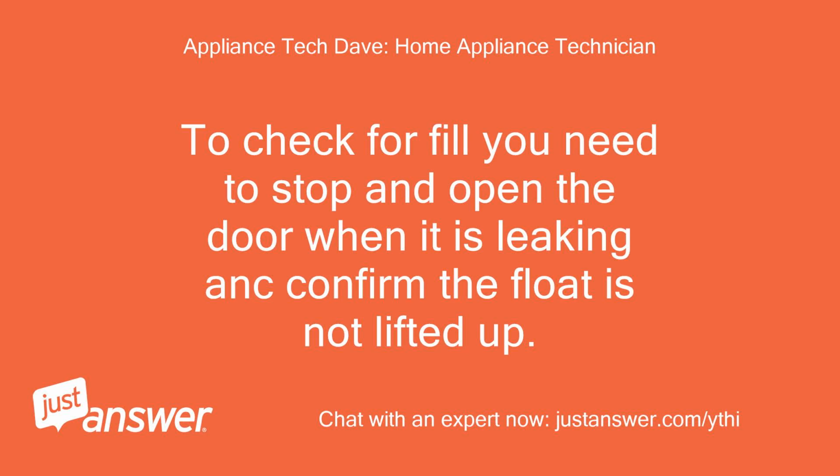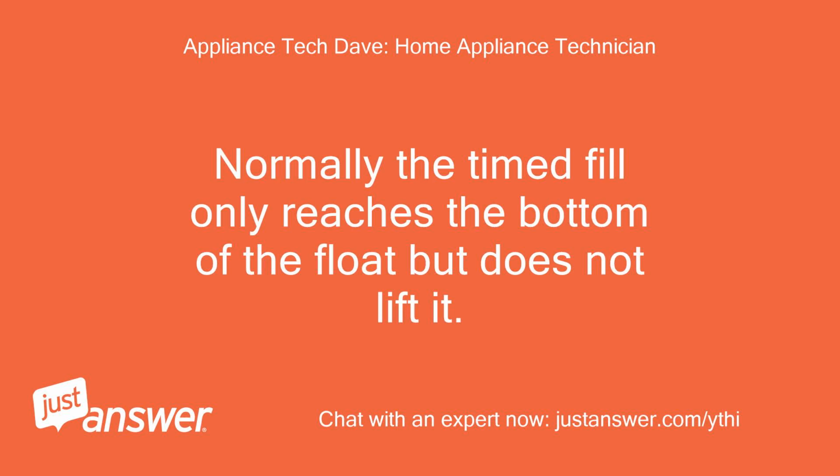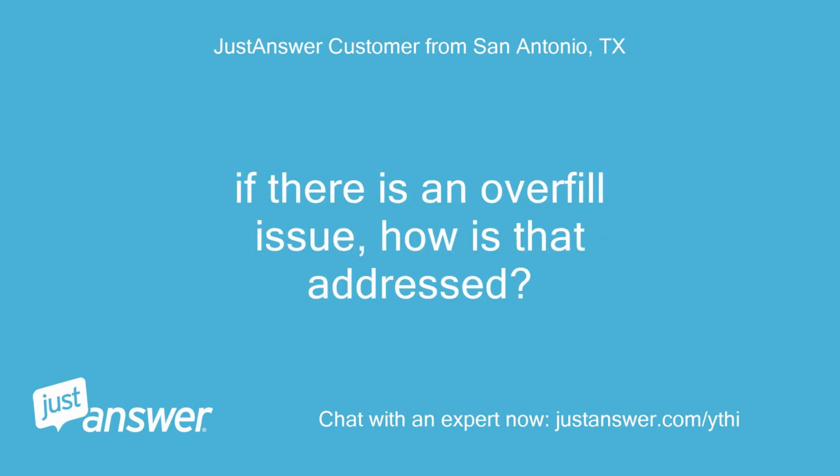To check for fill, you need to stop and open the door when it is leaking and confirm the float is not lifted up. It is an overfill protector. Normally the timed fill only reaches the bottom of the float but does not lift it. If lifted, it is overfilled. Should I try to run the dishwasher again? If there is an overfill issue, how is that addressed?